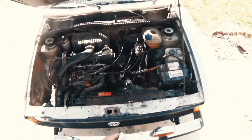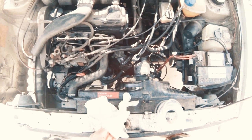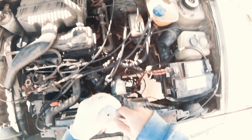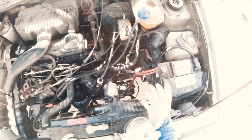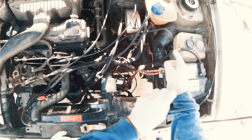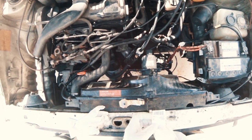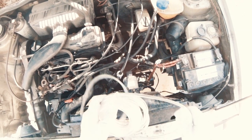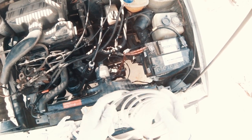We're going to bleed the master cylinder. I've bled all the brakes many times using the pressurized system — that could still be the problem, I'm not sure — but I've never tried just bleeding the master cylinder. So I'm going to run a brake line from my closest caliper. I'm going to use this clear hose and create a closed loop from my reservoir to my bleed valve on my closest caliper.